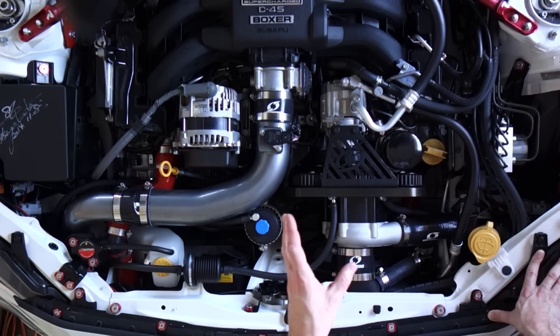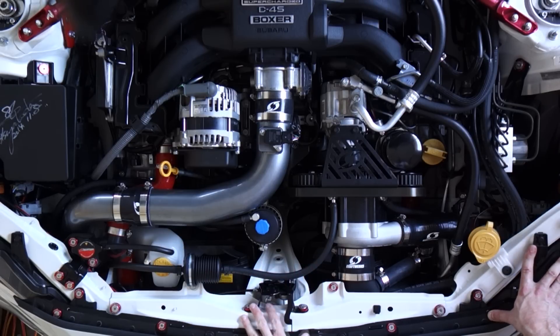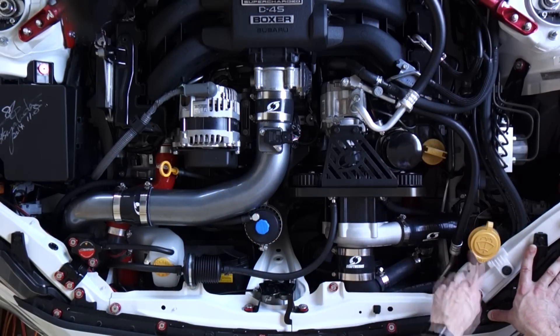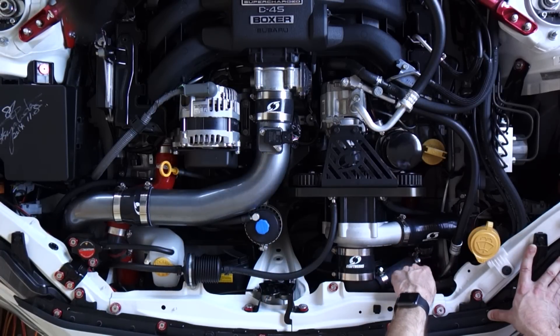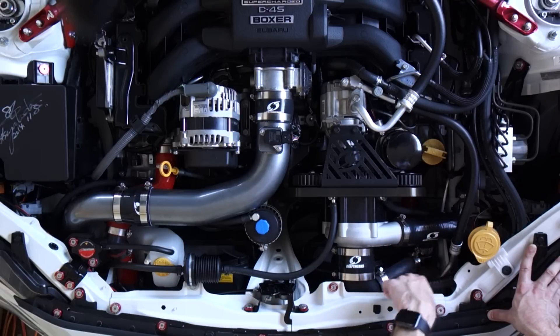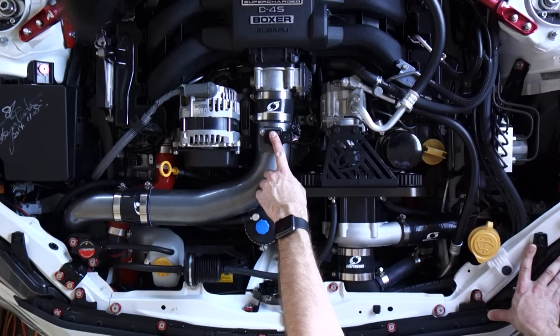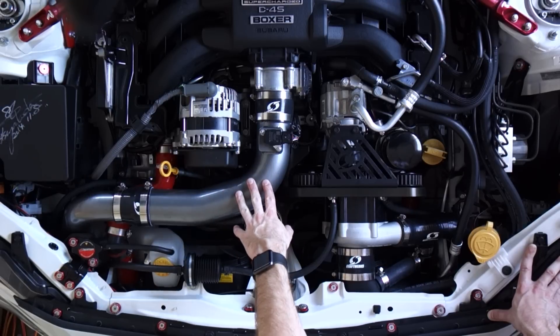And if you've got less air in the engine than the ECU thinks there is, then you're going to be running too rich - injecting too much fuel. In this system the air is coming in, being pressurised, and being measured just before the throttle body. When that valve opens, it's bleeding air back into the intake, but regardless of how that happens that air is still within the system and still being measured by that airflow meter once it goes into the engine. So the engine control unit knows exactly how much air is inside the engine at any given point in time.